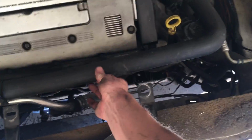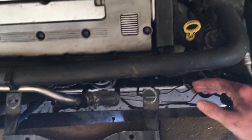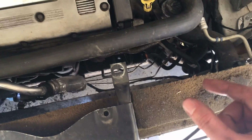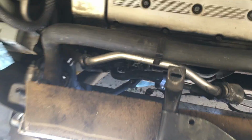You can take this rubber hose and loop it up over the engine oil cap and behind here, so you get more room. After you reach down behind and disconnect the wires from the fans, you have to lift them up, and there might be 2 tabs on either side that stick out, and they might hit these rubber hoses, so you're going to have to bend it properly. What I ended up doing, against my better judgment, was cut one of them off, because the left one looked like it was just sitting on the frame, not actually attached to anything, which allowed it to come up easier.